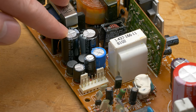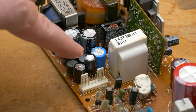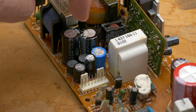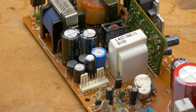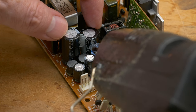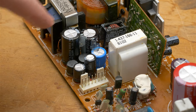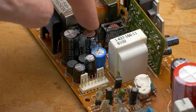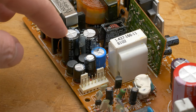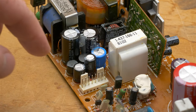There's a little wobble in the capacitors, so if you have hot glue I'd recommend adding a dab between these three capacitors to glue them to each other for stability. Your hard drive and other things will vibrate the case and you don't want capacitors vibrating around. Sony did basically the same thing with silicone on their stock components.